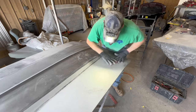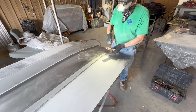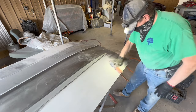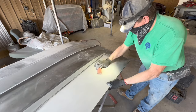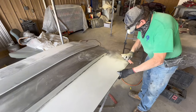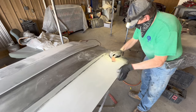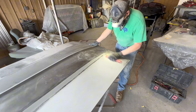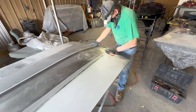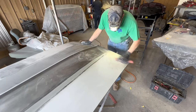As a side note, I was sanding the driver's side of the hood, which isn't on video, and up on the hood scoop next to the reverse curve, I had really low black still showing there where the round Durablock had cut out too much into the flat part of the hood. And so I took the stick completely sideways and blocked forward and backward, with the stick aiming out from the center of the hood towards the outside of the hood, and was blocking it sideways, which doesn't help the straightness any, but that's the horizon thing I'm always quacking about.